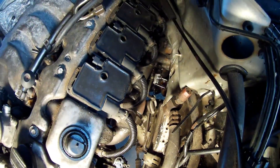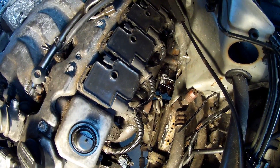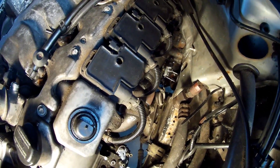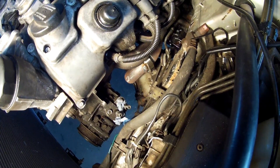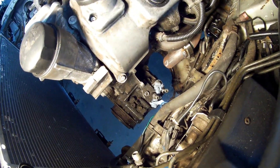It's still going to be a nice puzzle to route the three-inch downpipe through there, but I think I'll manage. The turbo and wastegate need to fit in here - I have an external wastegate so that takes extra space. I can't really show you the clearance between the steering box and the manifold, but it's tight yet there is space - about seven millimeters between the exhaust manifold and the steering box. The steering box needs to be isolated from the manifold in a way that still allows airflow. For the rest there is a lot of space in here. The only thing missing is the steering pump, which is out of the way to make working on the manifold easier.